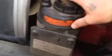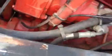All right, so over here we've got our power steering pump reservoir. You want to make sure that it's properly mounted and secure, and that the level is topped off. That leads over here into the hoses, right into your power steering pump. Again, if you see a hose, check a hose. Make sure it's properly mounted and secured, not cracked, damaged, or leaking.